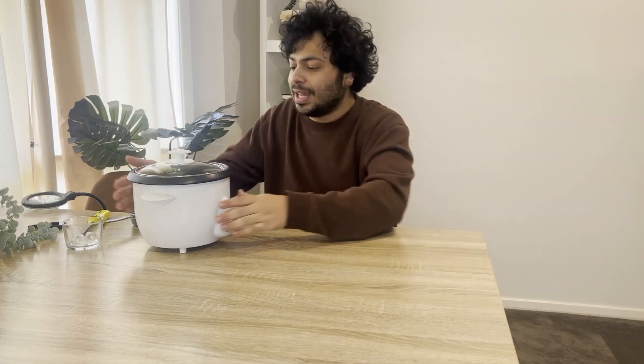And that's the trick. If we put the right amount of water in and start heating it, and we measure the temperature inside the rice cooker, we're going to know exactly when that rice is cooked, because we'll know exactly when all the water disappears. So while the rice is cooking and we're measuring the temperature of that water and rice mixture, it's going to stay at or below 100 degrees Celsius. All of that energy goes into turning the water into steam, and the water is also being absorbed by the rice. So the temperature will hover around 100 degrees, not above it.